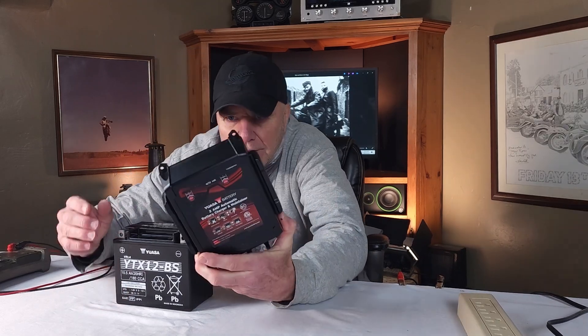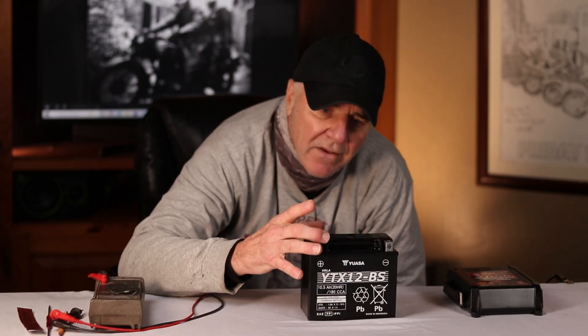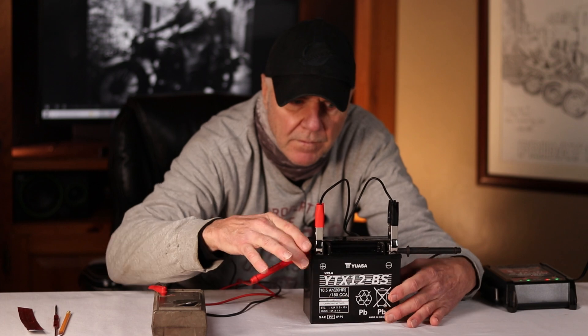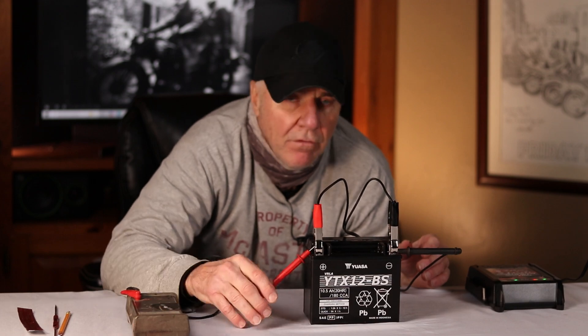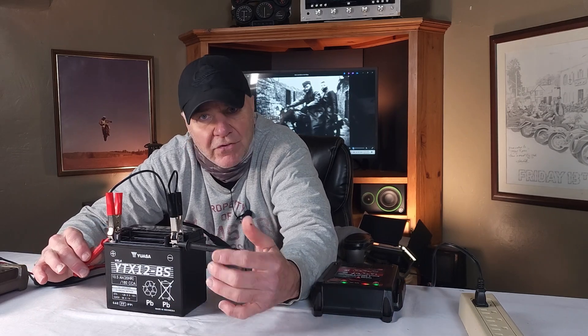But you want to give this battery the best shot at a long, strong life. So they recommend that you give it a good solid top-up charge to get going. Hopefully you have a decent charger — I've got this guy right here. This is actually a branded Yuasa battery charger, but you don't need that specifically. Anything that's a good battery charger maintainer type will do. It's a smart charger, so as the battery charges it adjusts and it's not going to overcharge the battery. Red goes to positive, black goes to negative. It's bouncing around about 14.8 to 14.9 volts — it's seeing that it needs a good dose of volts and amps. As I say, this is a smart charger — over time it will sample what's going on in the battery and gradually lower the voltage and current until we're sitting at optimum voltage. We'll leave that cook away for about four hours. I'll show you one more tip that most people don't do — stick around for that.